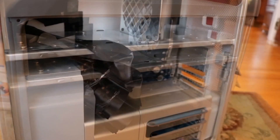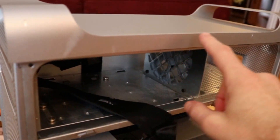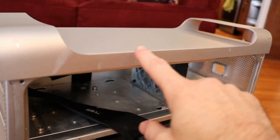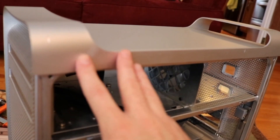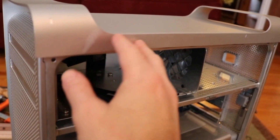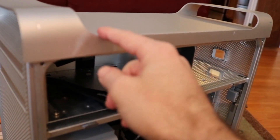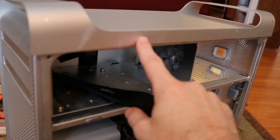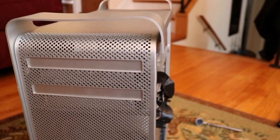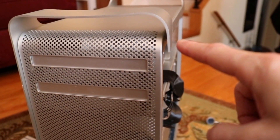That's a lot of work. What I'm going to try to do is take the eight screws off this end since I really only need to work on this area. I'm going to try to lift the skin up about an inch so it clears the top, and then try to straighten it. So I'm going to start by removing these eight screws along here.